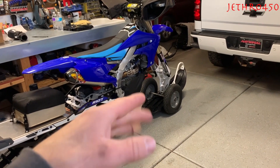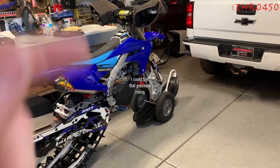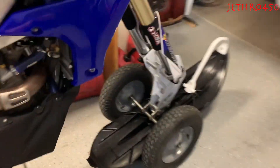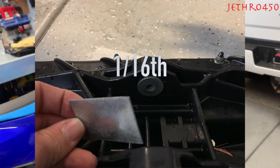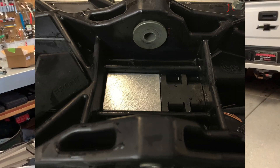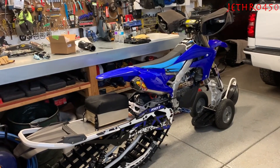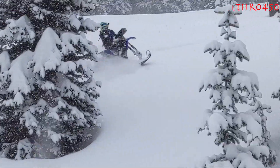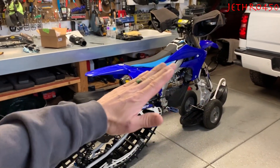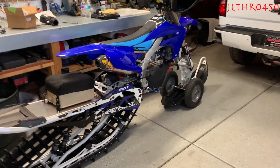I want to mention the front ski. In my previous video I showed how when I put the ski on the ground it felt like the pressure was more frontward. I did shim my ski — I put a metal plate underneath the rubber — and that has helped lift the ski just a tiny bit, and that made all the difference. On the roads it doesn't feel like it's digging in anymore, and even out in the backcountry in deep powder it's working great. If you go too far you won't have any bite at all and your ski will wash out from side to side, but I feel like I found a really good setup.